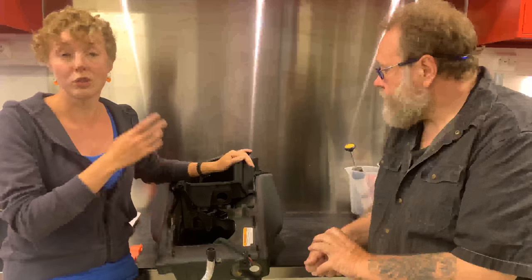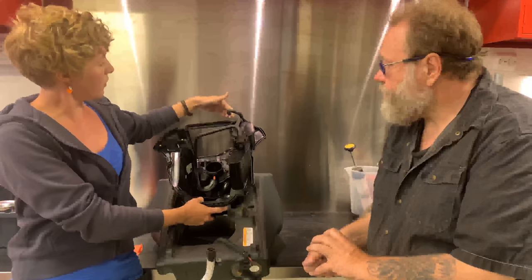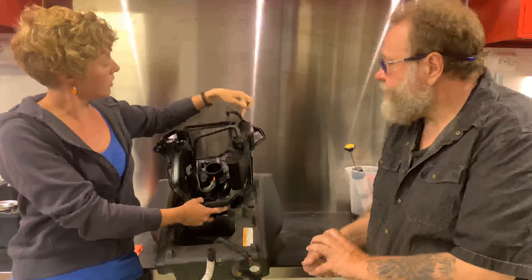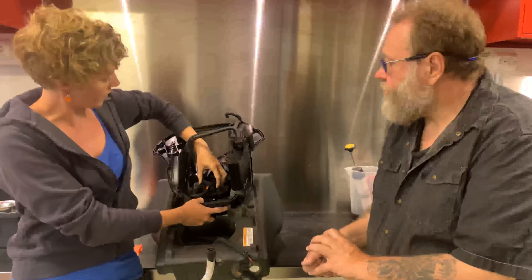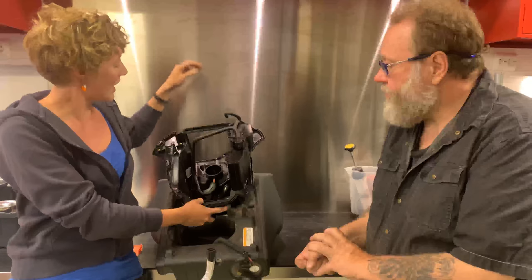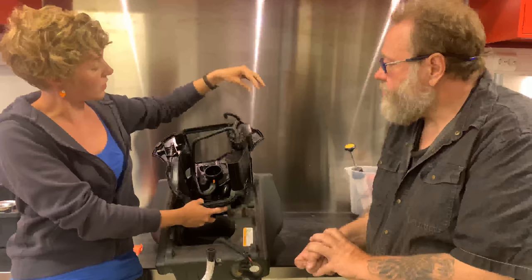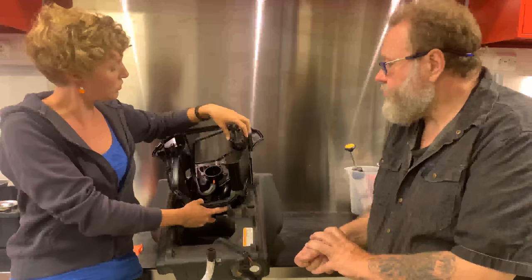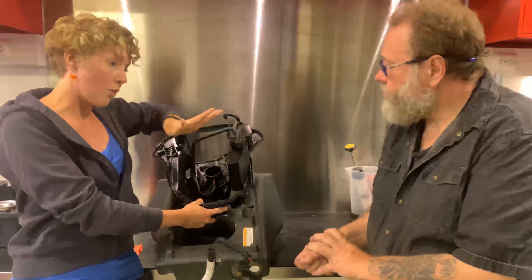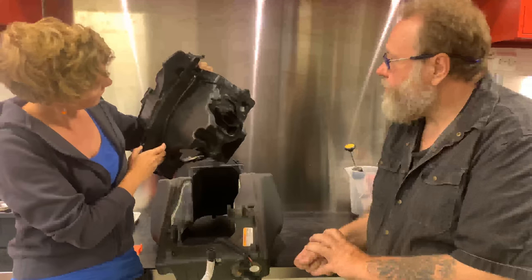We already opened it up before, but we will do it again, so you will be able to see it again. Basically what this does, I can just hold it like this. You have here your normal hose that comes from the vent. You have a little tunnel here that connects to there. Here you have your EVAP that comes from the intake. This is not what it usually looks like, but this is one that we have. It's not finished yet. It's one from the racing. So here the EVAP valve is, and you have the fumes coming from here, and both enter into this tunnel, and from the tunnel we go into the big canister, the charcoal canister. In here we have a labyrinth kind of style, so it's a maze, and I'll show you exactly how it's going through there, and then it goes out here under to the atmosphere, down here, that hole.